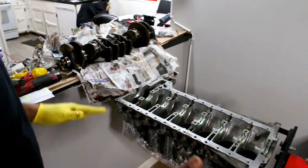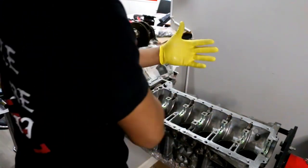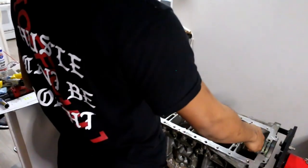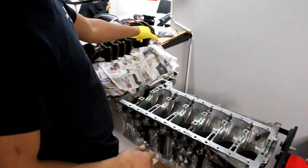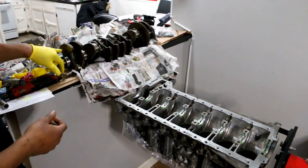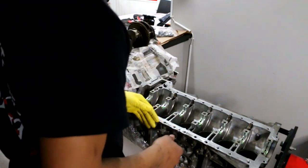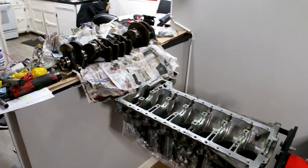First I'm going to make sure the crankshaft is clean. For orientation: there's a hole on the crank that indicates where the crank sensor goes, and there's a ring that needs to align with that hole. The front crank has the stamp with the bearing information and that goes toward the front of the motor. I'll clean it up and then drop it in.